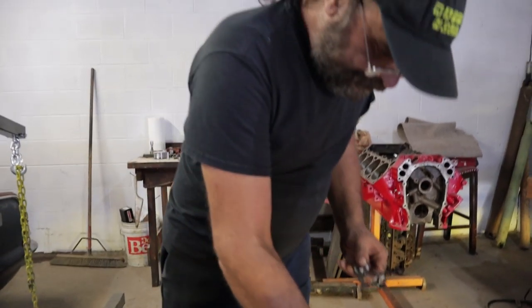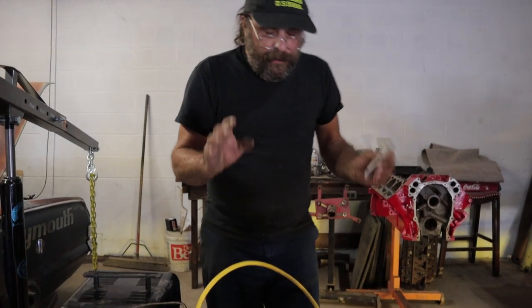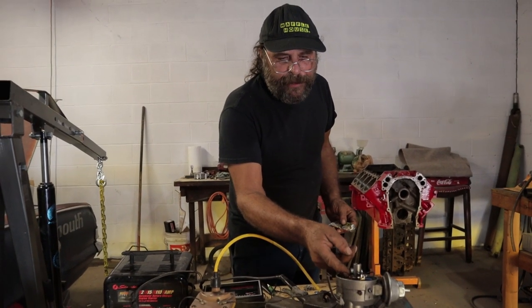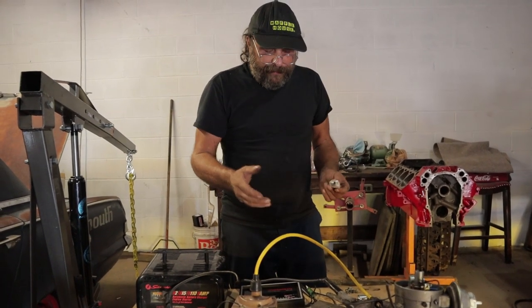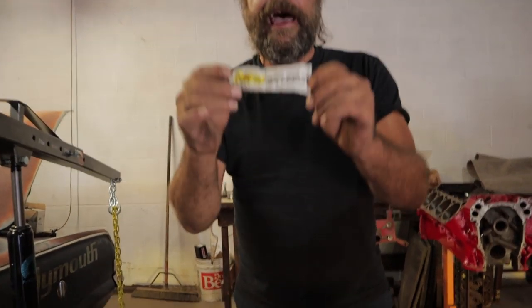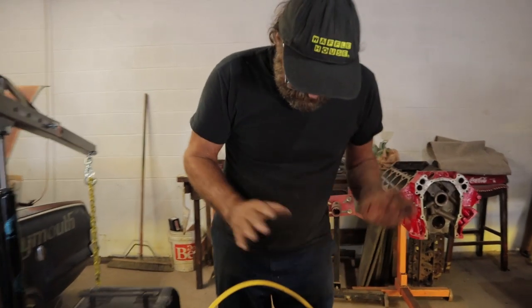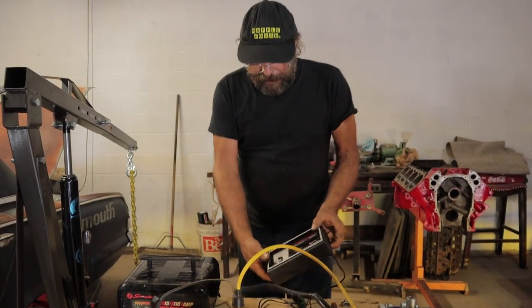You're going to need to grease these things. You can use something like wheelbarrow grease — just the slightest swipe of it on the cam lobes in the distributor. But if you're going to go all the way, embrace the points lifestyle and get yourself some actual points lubricant — look at the font on that, it's like right from the 70s.